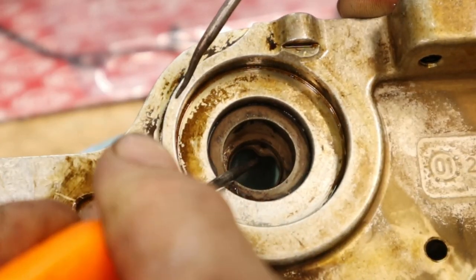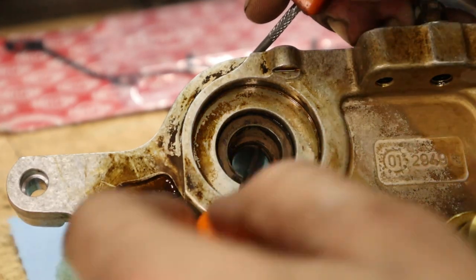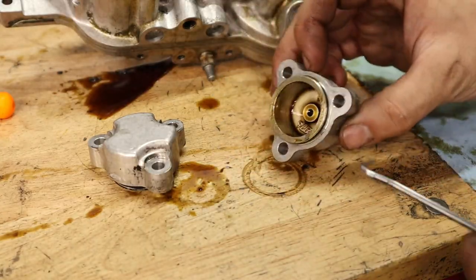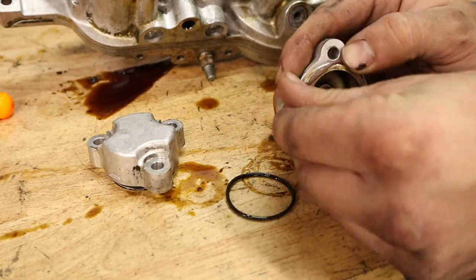You actually have to bend this thing in half very gently in order to get it into the groove here. And then once you do install the piston later, it's going to smooth out that fold, but it is a little bit sketchy when you do it, trust me.